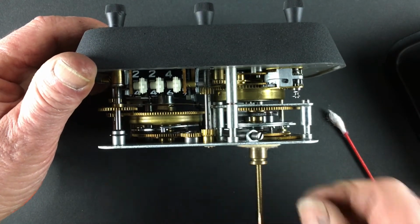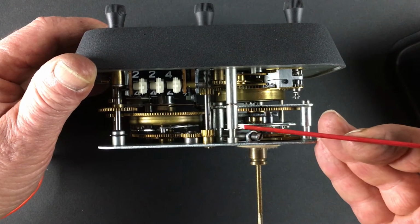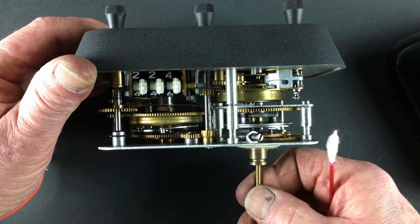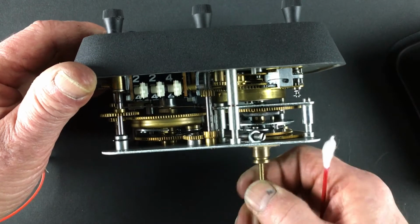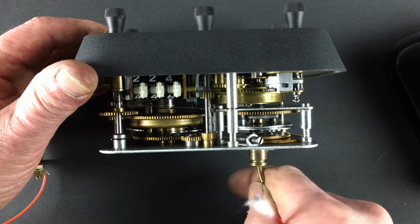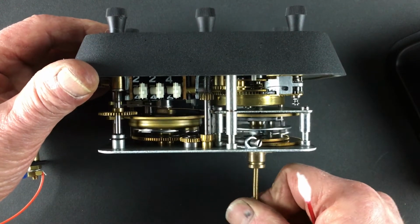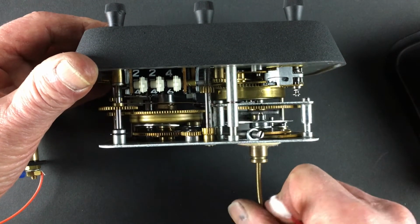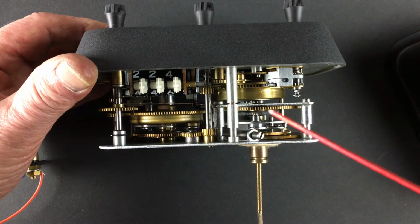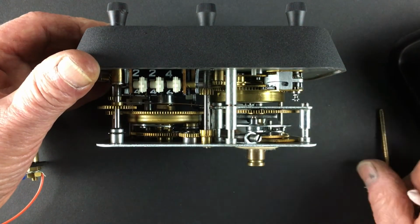And the way the adjustment is made is that there's a little pawl here. I don't know if you can see it, but that pawl engages the gear train for a certain amount of time. So depending on how you have the average speed set, it might engage that pawl for 5% of a revolution, or 8% or 10%, and then it basically goes on and off. It makes a lot of racket when you're actually turning it, and that's why it makes so much noise, because it's turning the thing on and off so that the numbers come out right. The rest of it is a conventional odometer gear train and a clock. Halda actually started as a clock company. That's kind of what's inside here.